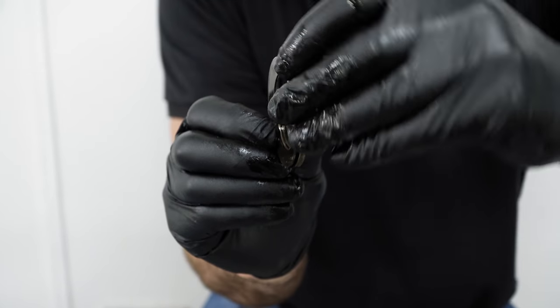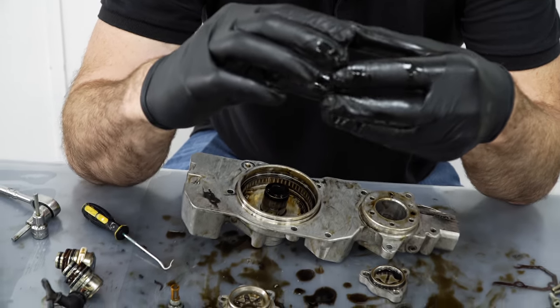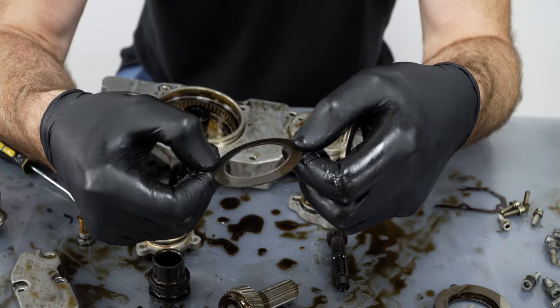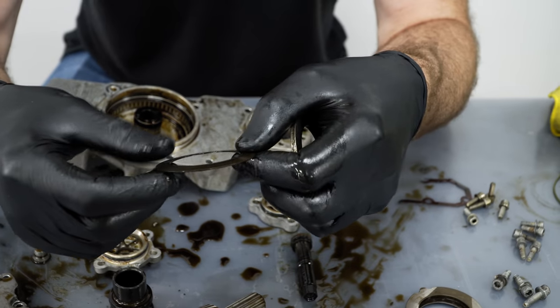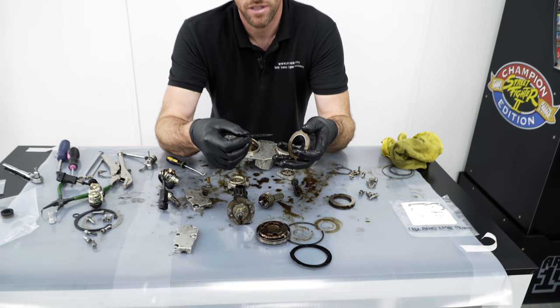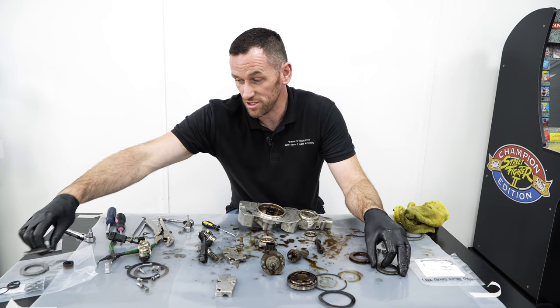And they create tension in the gear. Yeah, so they're just pushing against it. Pushing against it, yeah. And basically when these wear, when they get really bad, we saw one this week which was worn three-quarters of the way down. And that was particularly noisy from cold. So you turn the key, diesel growling noise, marbles in the cam, whatever you want to call it. It was doing that from the second you turn the key. Normally, they only do it when they're hot. So the thing is to replace those parts with a slightly different tension spring plate.